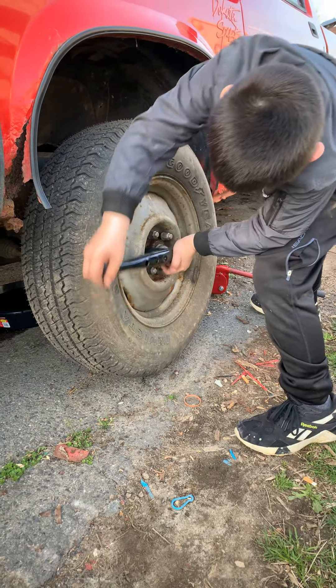Use this part instead of that part. That's your oil breather and pressure release valve. So you want to use that valve there, not this one. Give it a slight little twist to the left. I did not expect that — you did it too quickly, buddy. Now Chris, take the lug wrench and go opposites again and tighten up all those lugs. You want to push it down towards the ground — lean down on it as hard as you can. You can get better leverage if you stand up.